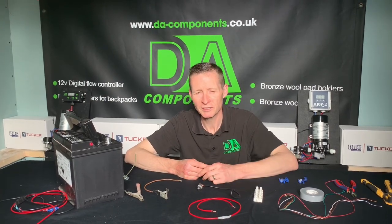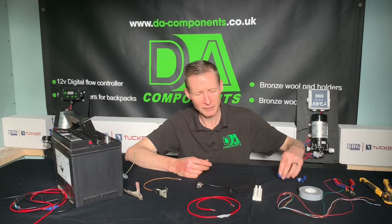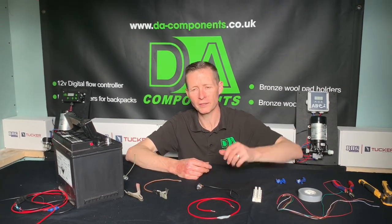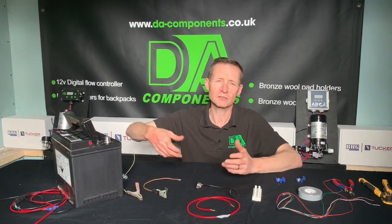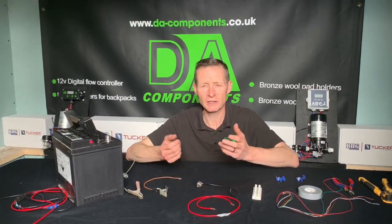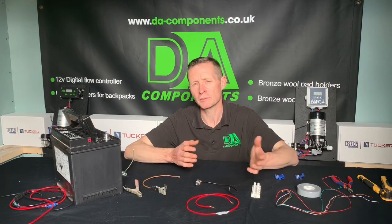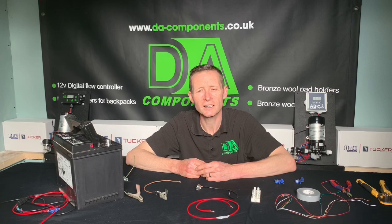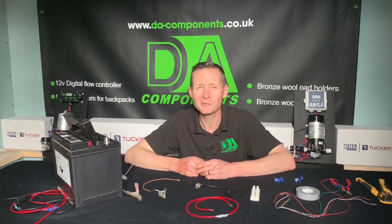So those are my top tips. Check the fuse holder, and check the outlet from the tank going to the pump and also the hose going to the reel. When you're driving about, sometimes something might just slide or fall on top of your outlet hoses. That's the new video from DA Components — thanks a lot.